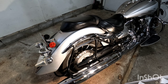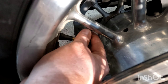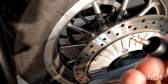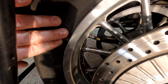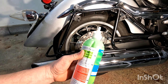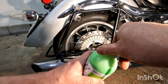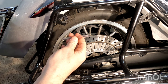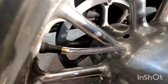What I'm going to do is remove the bag on the right side of the bike. You're going to want to put your valve stem so it's on the upper half of the tire. Take off your valve stem cover. On the top of your container, if you unscrew this, it has a core remover actually built in — as you can see right there. This is going to take out the core in your valve stem. So we're going to take out the core. You want the air to deflate out of the tire, which it does really quickly when the core is out.